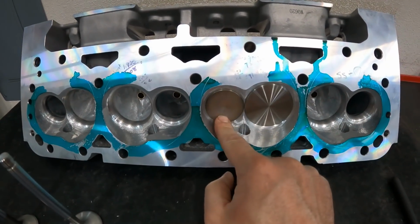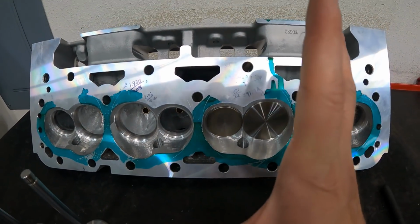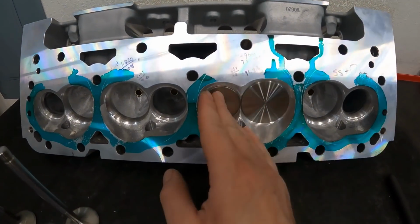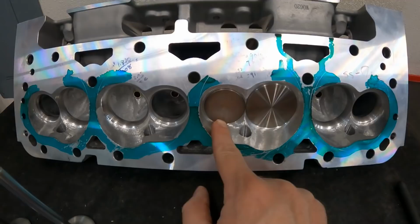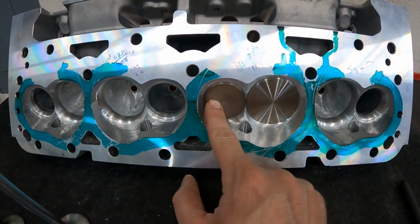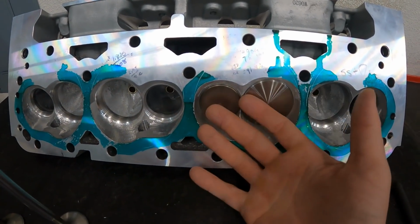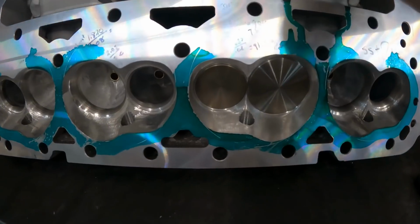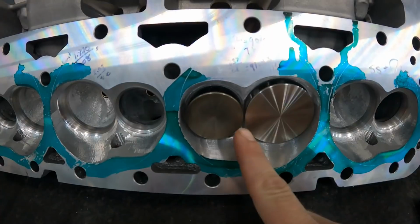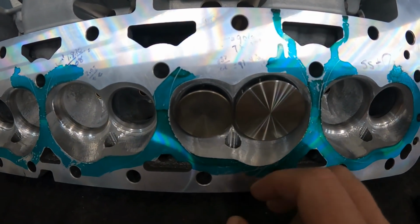That same thing happens inside of a cylinder every time there's a cycle. The gas expands, out it goes, low pressure is created, and it might come back, hence reversion. So our goal, whenever we try to design exhaust ports, is we want it where the gas is easier to get out, harder to get back. So hopefully that gives you some guidance on what I'm talking about. But the biggest thing is having the overlap, that's the part where the cam has both valves open at some point. Getting this timed right is so critical.